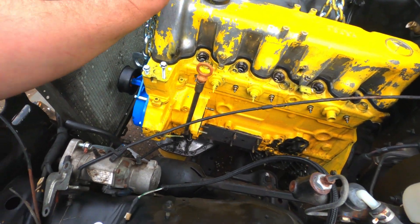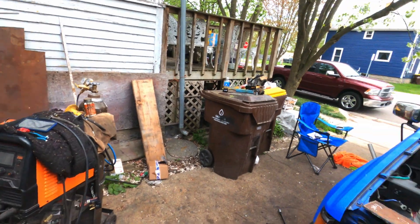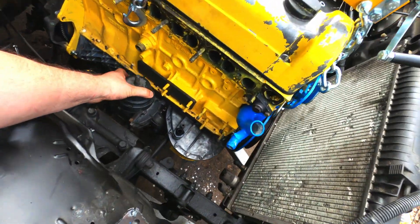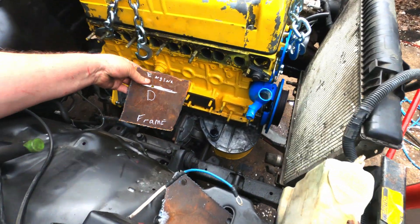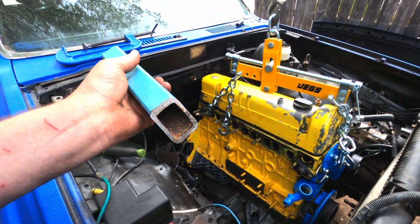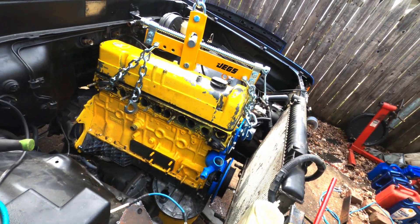I have plenty of room down there to my steering. I think we're good to go. I have these plates that are way bigger than I need. I have these hydraulic mounts from a Ford — like $32 for the pair. In order to mount without going all the way to the top I have to put the plate at the bottom of the frame rail, so I have to trim it up. That mount will go on top of it. Then I have this bracket I cut out of a table at work that they were scrapping — I'm going to chop it down to a couple inches. The nut that fits on this mount fits right in there with a socket; it's like perfect. So, just some fab work.